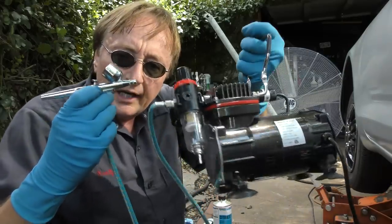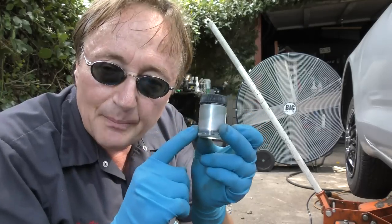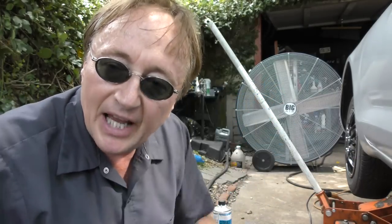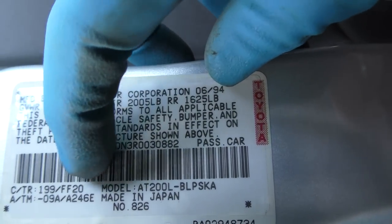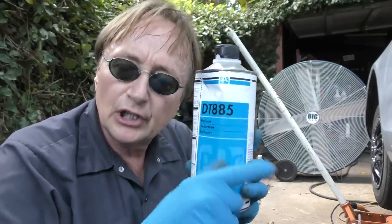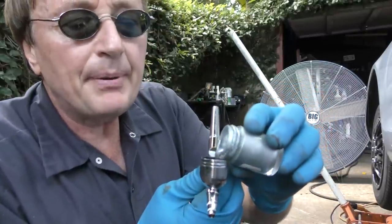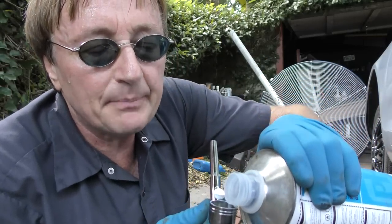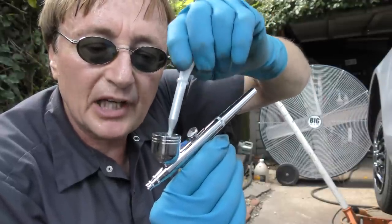Then you get out your little airbrush compressor and airbrush wand for spray painting. Get yourself some paint — I just took the paint number off this car, went to an auto paint store, and they mixed me up a tiny batch. If you're curious, here it is on the door jamb — color trim, there's the numbers for the paint. Make sure you have a little reducer to thin the paint. I use 50% thinner and 50% paint on a job like this. So we pour half paint and half reducer inside — I got this at the same paint store. Then you mix it all up inside this little eye dropper that comes with the airbrush kit.